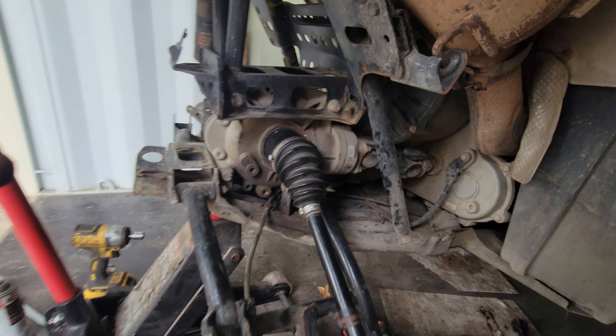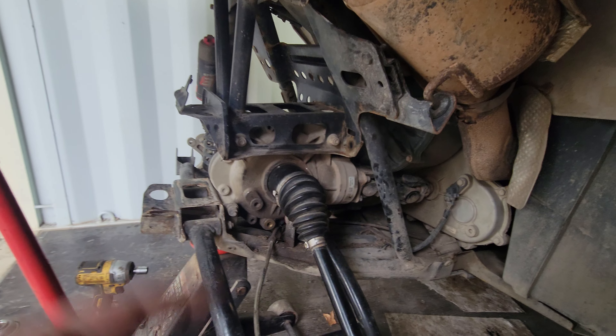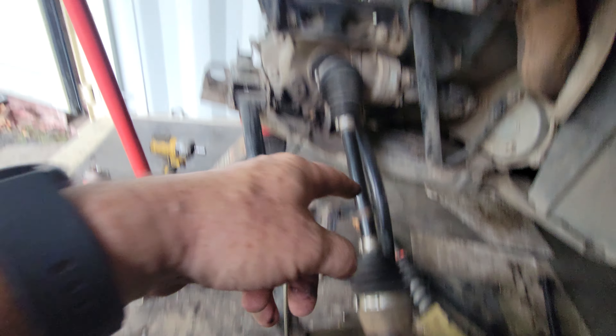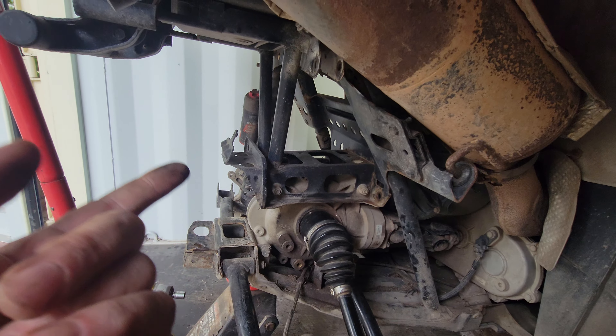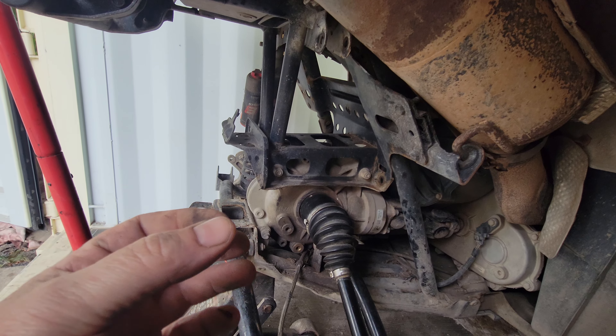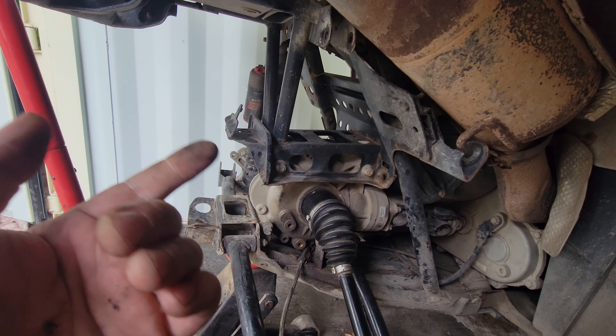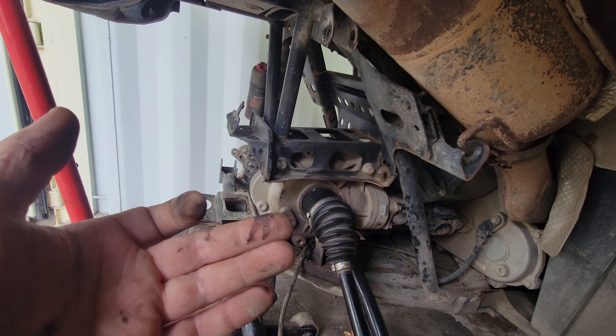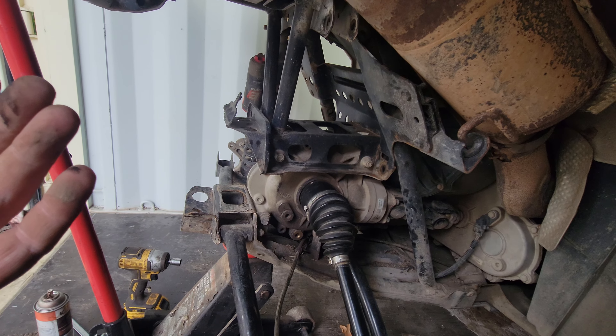I have to finish putting this all back together again. I've got brand new bearings in there, which I showed you guys before. I never did show you how to put these bushings in — I think I showed you how to get them out, which was screwdrivers. I just used a socket to start them, get a socket on it, and knock the bushings back in. Pretty straightforward.